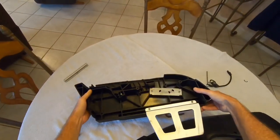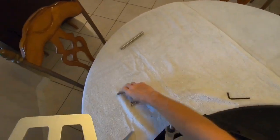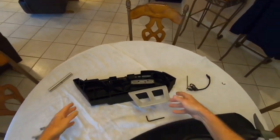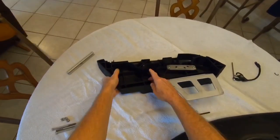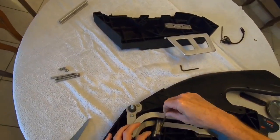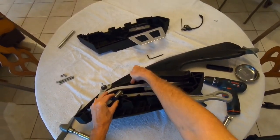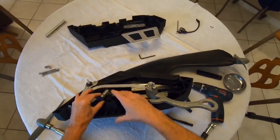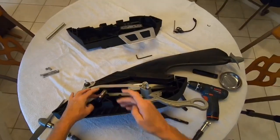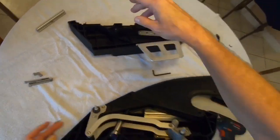And here's the bolts. We drop those out. Those are the ones we had loosened here. So let me put those over here. And there it is. That's one complete piece. And you'll see, notice this little pin right here. That comes out, it goes right there. It also goes in the hole right here. The purpose of that is to hold this drive shaft in place as it comes from the lower skeg up through, and that's what holds this in place. Okay, so you have that. I'm going to put that back in that side.